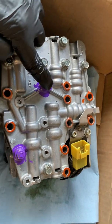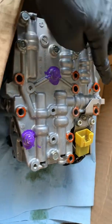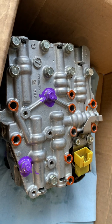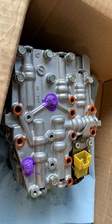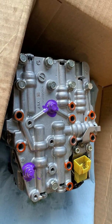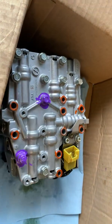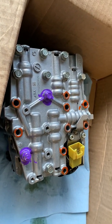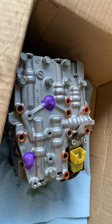Those are the two that go all the way through. This one is right beside your lockup duty torque converter lockup duty solenoid; this one is right beside your all-wheel drive solenoid. These are marked orange-red because these are the bolts that you remove when you take this out after you pull off your outer valve case. You take out your valve outer case and this control valve body is sitting in there — take out those bolts marked orange.